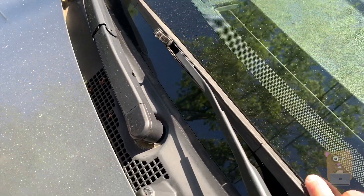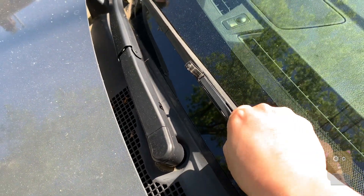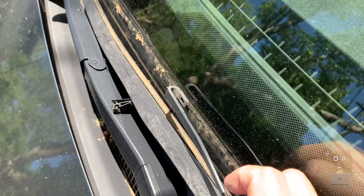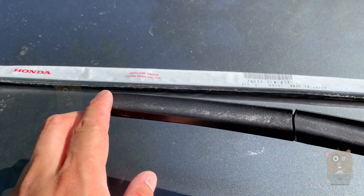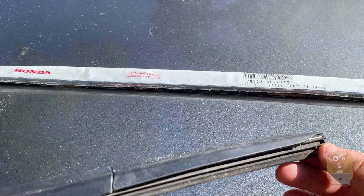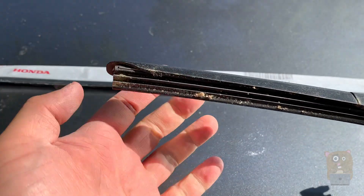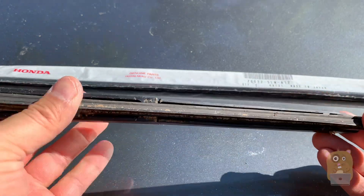The blade itself — I'm going to pull it towards me, towards the driver's side. See how it's being shifted. I'm going to lift this up and place it gently back down. I don't want to slam it back down because it will break the glass. If I just gently set it back down, it's actually not touching the glass right now, so I'm going to leave it there for a minute. This side was facing towards the passenger side; this side was facing towards the driver's side. Notice the grooves. This one is capped, whereas on the other side there's no cap. So what this means is I'm going to push this side in this direction — towards my right — and once I do that, this side pops out. I can pull from this side too, and slowly slide it out.